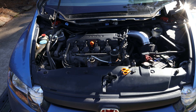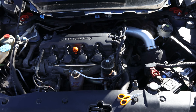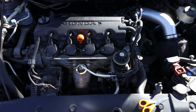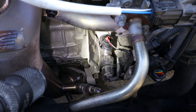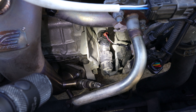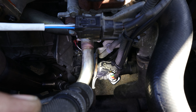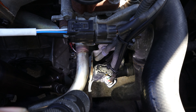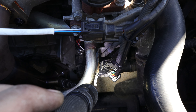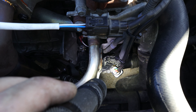The O2 sensor connector that goes through the firewall is a lot bigger than the oil pressure sensor version. I'm going to take a long Phillips screwdriver, add some electrical tape around it, stab through the grommet, and route the O2 sensor wire harness towards the same location as the secondary O2 sensor on the stock engine. The Pro Sport wideband air fuel ratio sensor has a very long wire harness already, so pre-routing it near the stock secondary O2 sensor connector should work well. It took me a couple of hours just to get everything routed through the firewall.